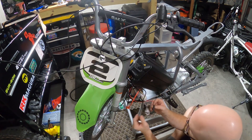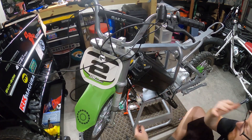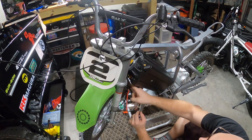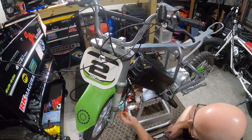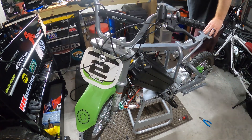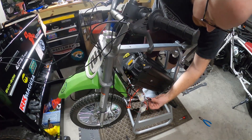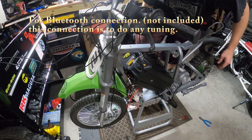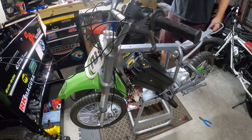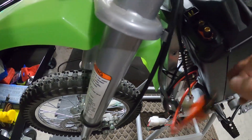We're going to do the same thing with the throttle — feed that down best as we can from the front and make sure the turning is not going to affect anything. These wires are shorter than I would really like them to be. This one's really short — look at this, it barely fits, barely snaps in, but it's not hurting anything when I turn, so I guess we're going to be okay. Then you've got this one round connector. That just leaves the Surron battery. You know if you did this kit and bought a battery from Electro & Co, it obviously wouldn't be as big and you could mount it down here really nicely. I would put the controller up here or on the front inside of the frame so it can catch some wind. I'm going to need to get all these wires out of the way but that is the last step in this install as far as the wiring goes. I'm going to double-check to make sure nothing is going to get cut when turning. Looks like we have one excess wire that I have to look into, but we should be good to go.